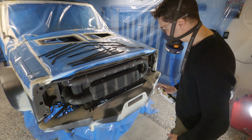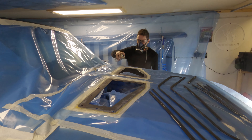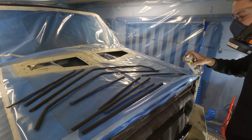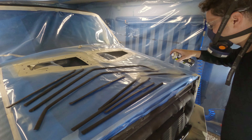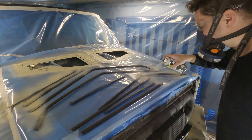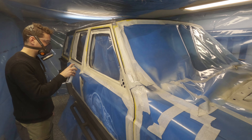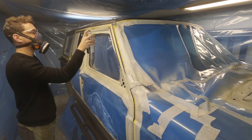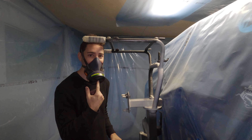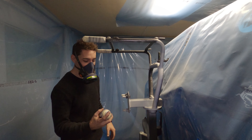It kind of looks like I'm spraying the whole bumper here, but I'm not — it's just that there's a lot of patches where I've exposed bare metal, so I need to hit them with this. So I started spraying and I realised I actually had the wrong filter in this little thing here. I've just put the gas filter in — oh my god, what a difference. I was dying before but I just forgot to put it in; I thought it was already in there.